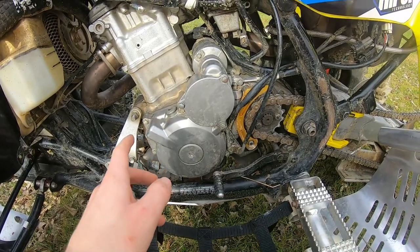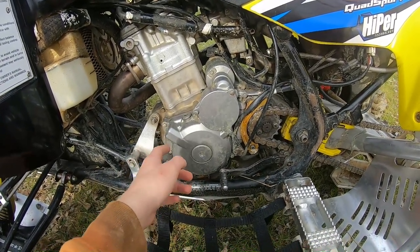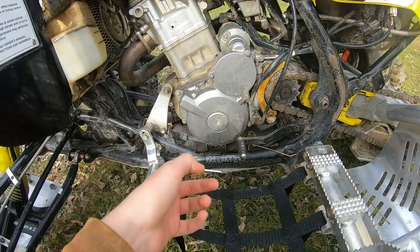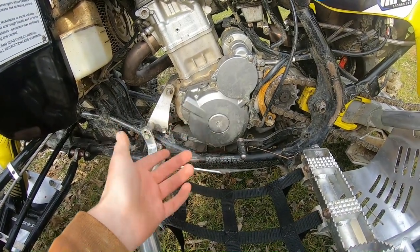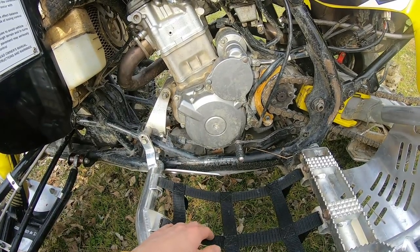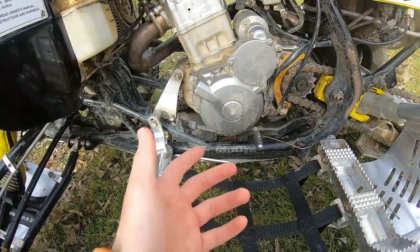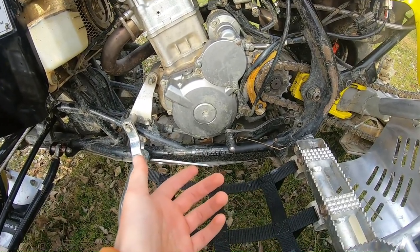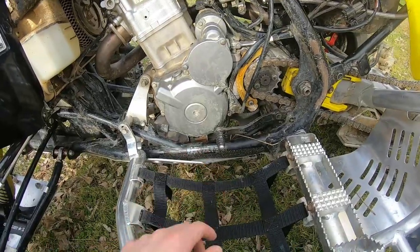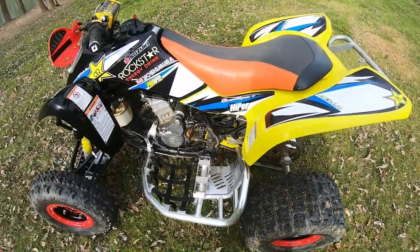When I did the new cases I had to get new gaskets. The cylinder was still good, the piston was good, the crank was still good — something had damaged the crankcase. It looks like someone had tried to repair it before and put new gaskets in, but messed up the transmission. I didn't want to mess with the cases because they cost a lot of money. I also rebuilt the rear end — put new swingarm bearings and linkage bearings on it.